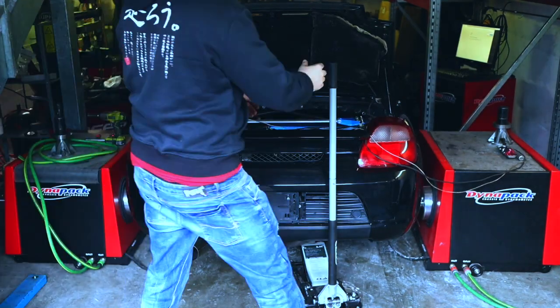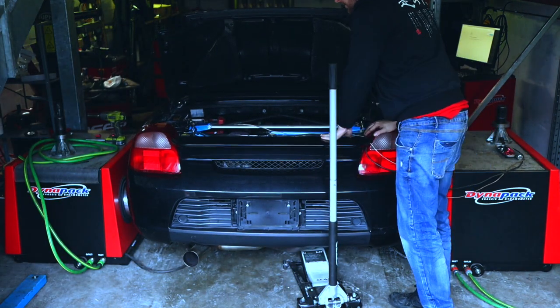This is also why I decided to go with the hub dyno — it's very flexible and can be put aside once the car is tuned. The car is on the dyno now. Next step will be to start running it in, checking idle, making sure everything is running correctly, and then I'll start adjusting the fuel tables — that's the first step.